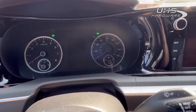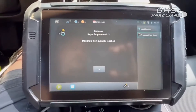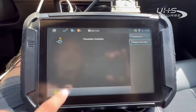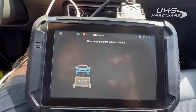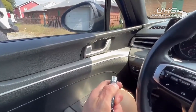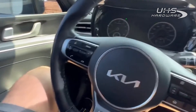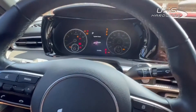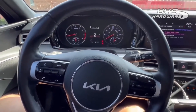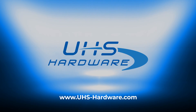As you can see, between the 160 and the full for fuel, it went on and went off. Maximum key quantity reached — hit okay. We're going to go ahead and be done, disconnect, and shut our hazards off. This is our new key right here. It'll start — we have both keys in here. So that's the 2022 Kia K5 spare pin code pull and programming.